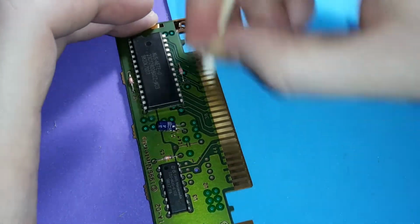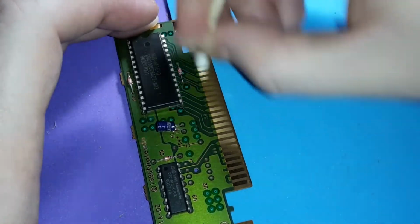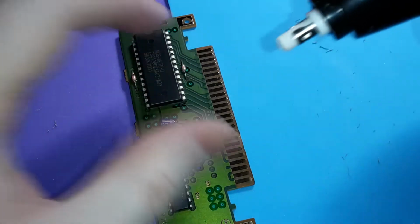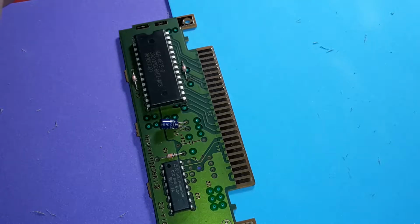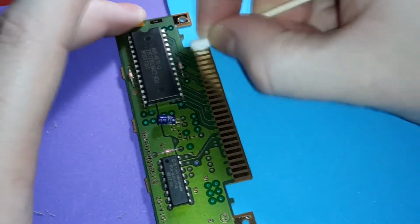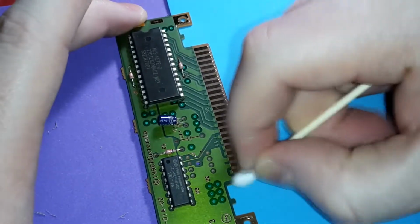Yes, I had to worry about that too with the electric eraser. With that center post, this metal segment will grind up against it, and it makes a terrible noise, so it kind of wakes you up and startles you, like, maybe I'm pressing a little too hard, or I need to extend the eraser out. And that's another one of these processes: what would make it comfortable for you to clean these games.